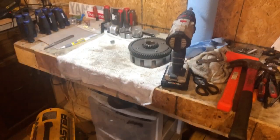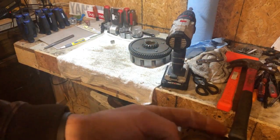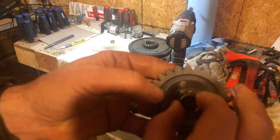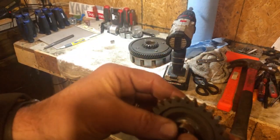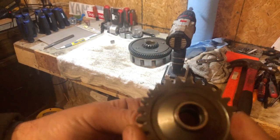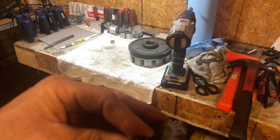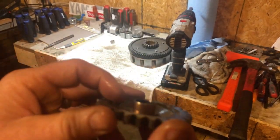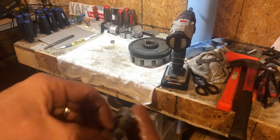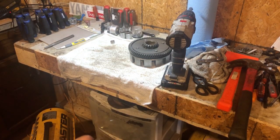Conveniently have these clutch fibers right next to me here. A little bit more lubrication on there. And try and get this pressed in there, guys. Okay, so same thing. Just gonna make sure it's, see that's kind of seated a little crooked there. That's what you don't want. It's gonna bind up on you. And yeah, you don't want that.